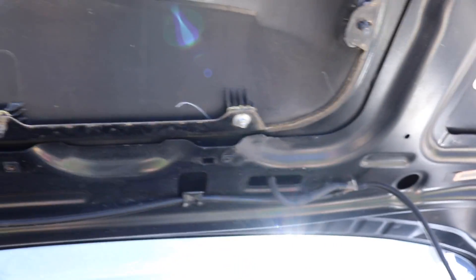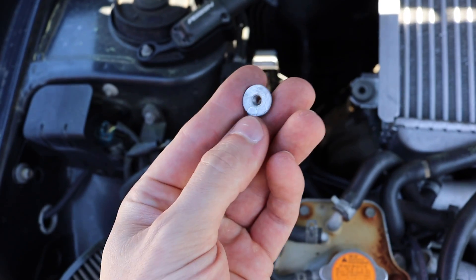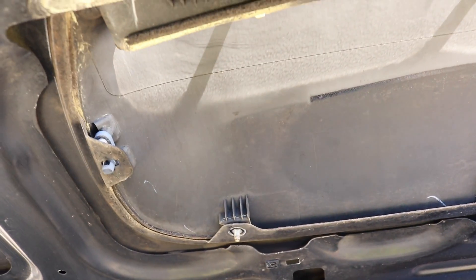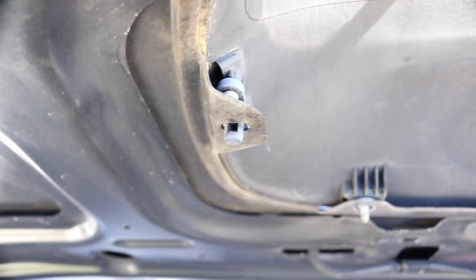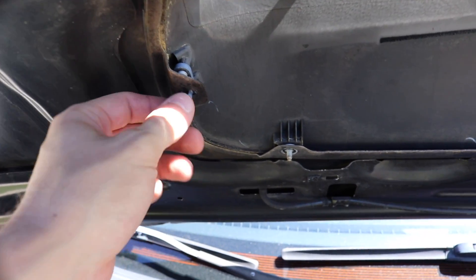Now I just need to get the scoop out, which is the rest of these little bolts here, here, here, here, and here. Once we take those out the only thing holding it in looks like these little blue tabs — you should just be able to squeeze those and push it out. Once you take these little guys out you can see they just come off, they're like little washer wing nut kind of things. Now, this is a 2005 and these haven't been changed — when I pressed those tabs they just snapped straight to the inside, so those are broken. Good thing I'm not going to reuse those, but if you're doing this to just replace your hood scoop those may break because they're brittle, so you might have to get new ones.